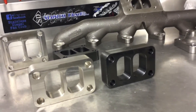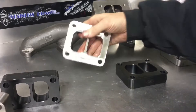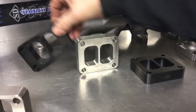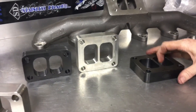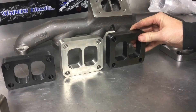So the flow's right there. The fitment's good. And here we have our stainless steel, 1-inch thick, CNC'd flange — gasket matched to T4, as opposed to your smaller T3 size here. And this is our mild steel flange. It's identical with black oxide coating.